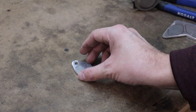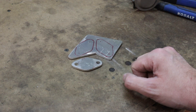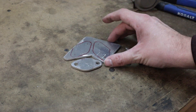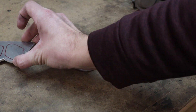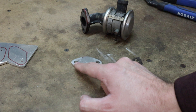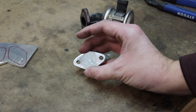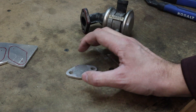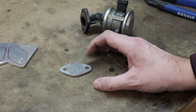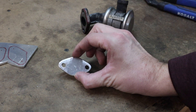Here is the mostly finished product. I'm going to smooth it out just a little bit more, but that's basically it. I did start the holes with a 15/64th size bit and then bump up to a quarter inch. Some of these are just slightly oval shaped - I'll get them close. You'll get the 15/64th and get it on there, see where it needs to be adjusted, then bore them out just slightly bigger. And that's all there is to it. I'll smooth this up just a little bit more and we'll get it put on the car.